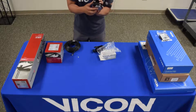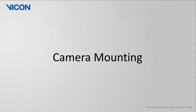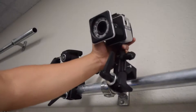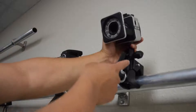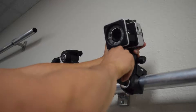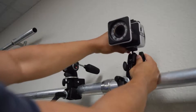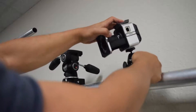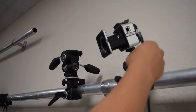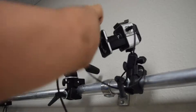In either case, the bottom of this camera mount can also fit into the super clamp or onto the top of a tripod. When mounting your Vero camera to a speed rail, make sure it's attached to a super clamp with a micro ball head or an 804 RC2. Loosen this screw so the opening gets larger and fits around the speed rail, then lock it into place. To change the camera's position or angle, unlock this button and a universal joint allows the camera to move freely. For cable connections, take the Ethernet cable and using the end with the ferrite core, plug it in — leaving some slack should you need to move the camera's position.